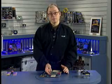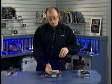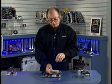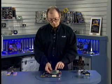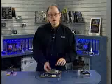They usually don't warranty that type of failure because it was caused by improper installation. To help ensure the heat sink is firmly seated and not pressed in on an angle, there are four pads — one in each corner of the processor. These are just an installation aid; they stay on there and serve no purpose other than to help prevent rocking the heat sink back and forth.